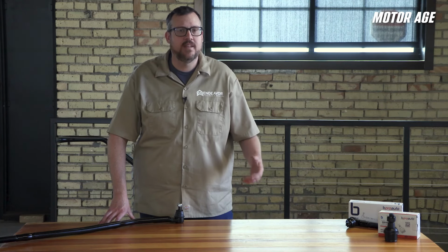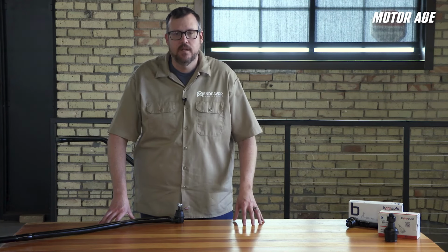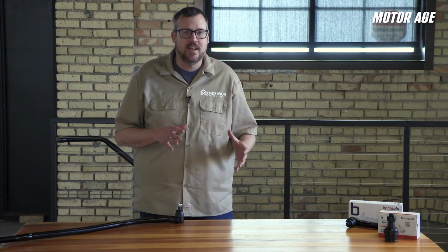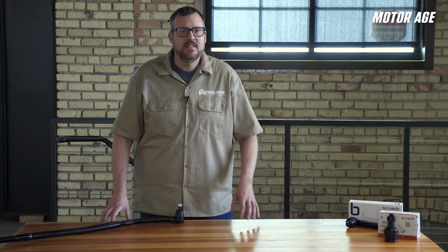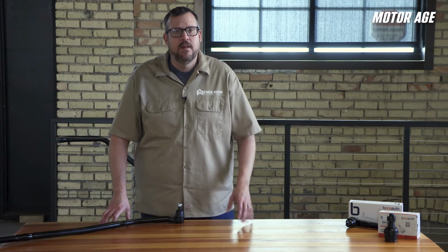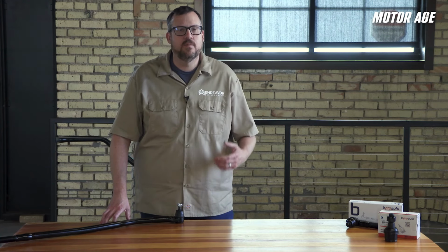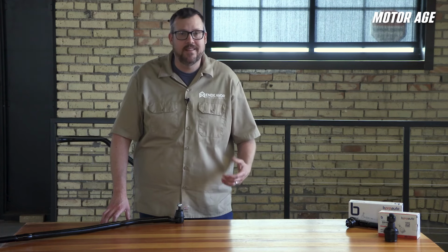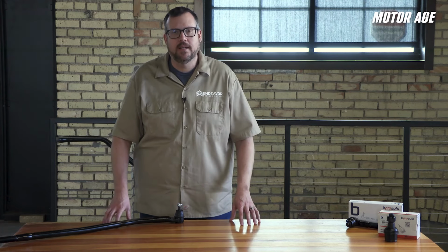Also, a solid axle can often incorporate a telescoping designed upper ball joint. Found in many Jeep and Ram applications, the telescoping design allows for manufacturing differences between the axle itself and the knuckle. This helps reduce issues like binding and memory steer. That is why looking at service information is so important, because many of these applications will have play in the upper joint right out of the box.